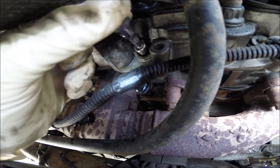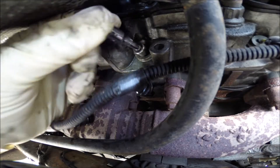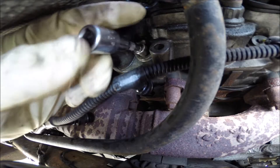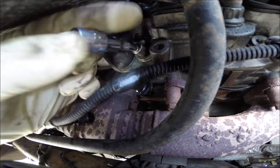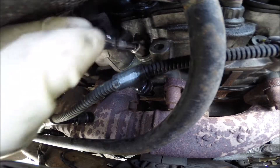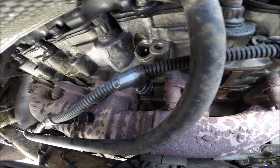I've already done number five and I got a two-pack of glow plugs — that's how Ford's shipping them now. So I figured I'll go ahead and change number three as well since it's difficult to get to. Since last year I lost number seven, that'll be almost all of them for this side. I think I can get number one from the engine compartment when it fails.